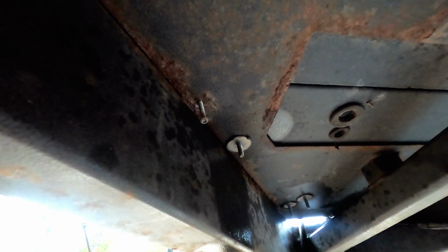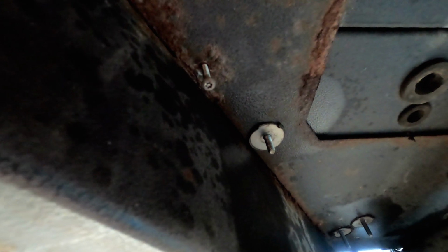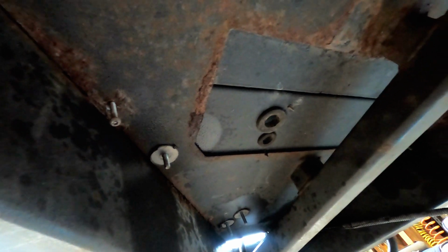So the last thing I had to deal with was the ground bolt. On the outside they used one of these security stars. Didn't have that, but on the inside they had a couple bolts that were easy to loosen and get all the ground wires off. And after doing that and removing the ground wires from the 110 junction box on the inside, I was able to pull all the wires out. So all wires are now free from the battery box.